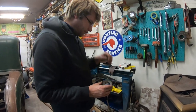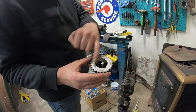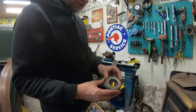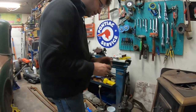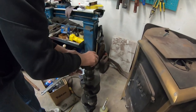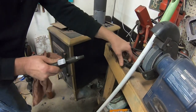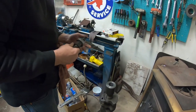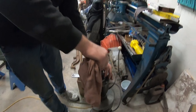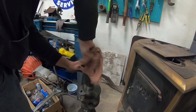We're going to throw the crank gear onto this 454 crank. The timing set we got is a nine-way one with three different marks to advance and retard with different keys. Since this is a stock engine, we're just going to go straight up on a rectangular key — if it were a performance build we'd degree it. I just like to put a light film of oil on it, put it down, put a spacer on it, then put our harmonic balancer tool on here to use a little hydraulic force to press it down. Usually these things aren't that tight.